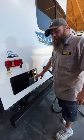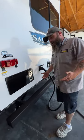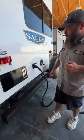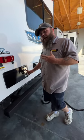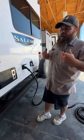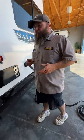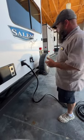For the furnace area, try not to block these vents so it can properly breathe. I recommend getting mud dauber screens — roughly $15 or less depending where you get them. If a mud dauber or wasp nest gets in there, it creates issues with the furnace and it would have to get pulled and serviced. Most shop labor rates are at least $140 an hour, so $15 compared to that — let's just be smart.